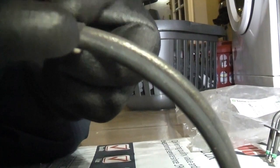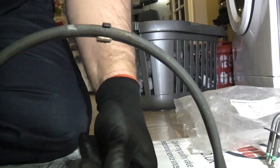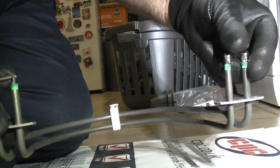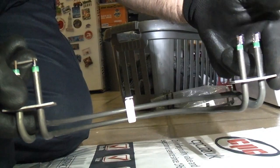In the video I actually tried bending up that clip to remove the element, but luckily the clip was broken so I managed to remove it with the fan blade in position. In most instances you are going to have to remove the fan blade to get to that screw before removing the element. This was an absolute bargain — just £30, and I also picked up a spare bulb for the oven at the same time.